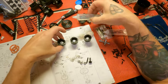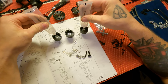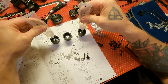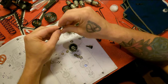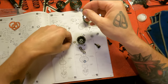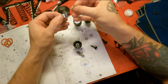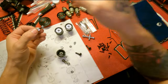Go ahead and start filling the front and the rear. I had to take a quick little break because the GoPro died. I went ahead and knocked out those two and saved one to show you guys. Put your gears on here, grab one of these little washers — there's a smooth and rough side if you can feel it. I always like to put the smooth side towards the gear. You can even be OCD and sand these if you want to, but that's a bit much.